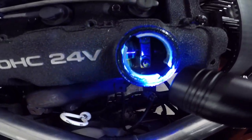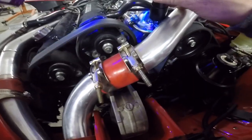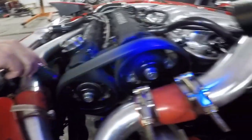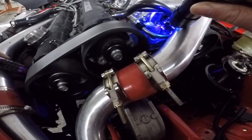it's orange, like that. Can you guys see the orange? See, it's like an orange. Everything that I'm sitting here pointing out is just green, and I think that's just old oil. I don't think it's gotten heated up enough to leak, actually. Back there, soaked, but see, all this green is just oil I didn't clean up. I don't think this is the actual dye. I think oil by itself shows green. Got a horrible tick coming out of that. Even back there is showing green, and that's just from it being flung over there before. It's not flowing there now.